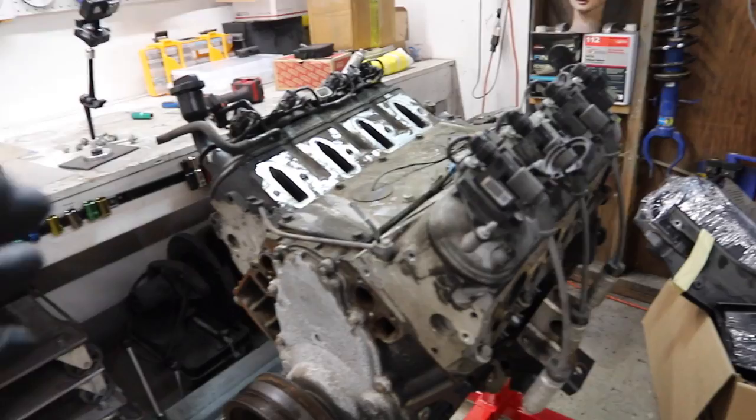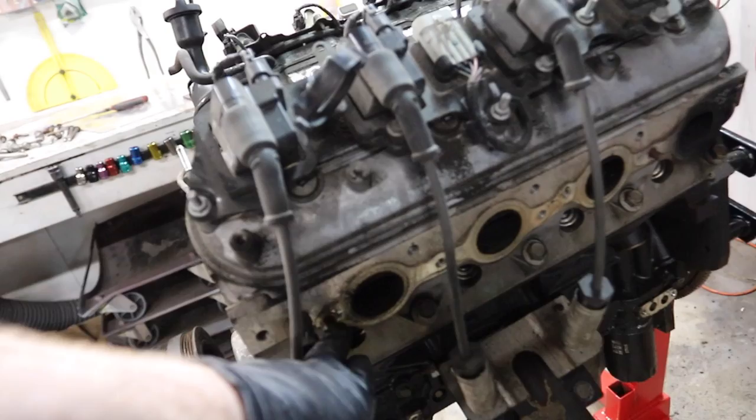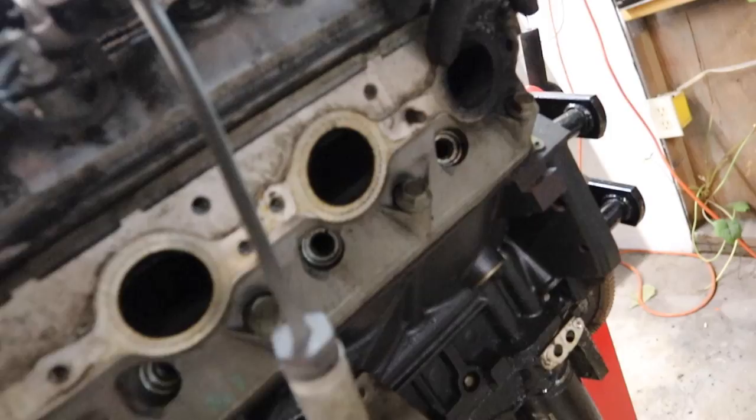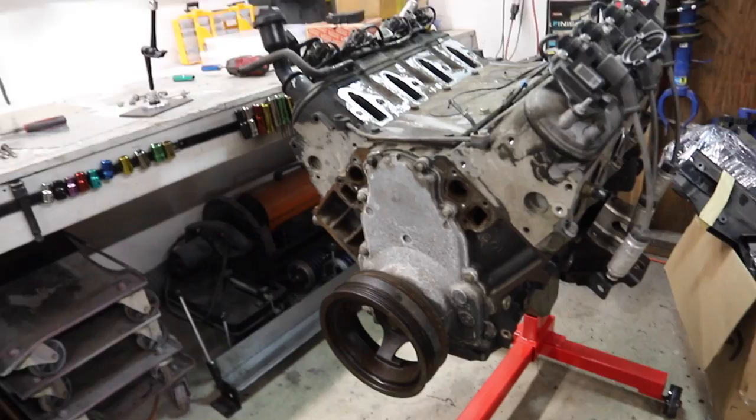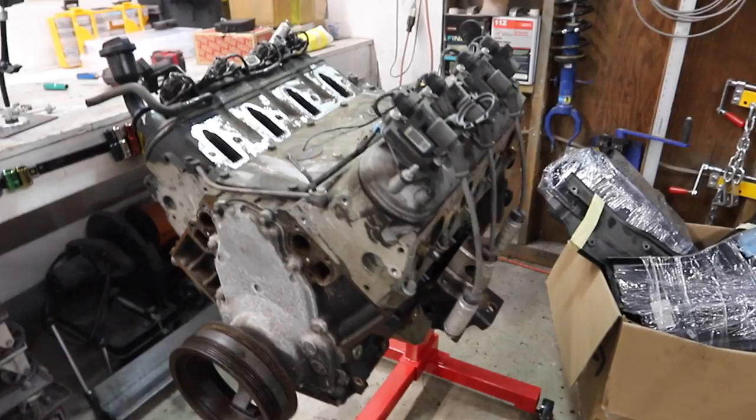But when I got to the exhaust manifold here, you can see that there are two broken off bolts, maybe even missing a third, or a blown gasket here, because you can see how much soot and everything was outside of that cylinder. And one more on the back side over here was broken off as well. So this thing definitely wasn't new, in the fact that it had been used enough that somebody needed to work on it in the way of pulling off the exhaust manifolds, and then broke all that stuff and never replaced it. So that's all bad signs, but keep in mind that we're just looking for the block condition.